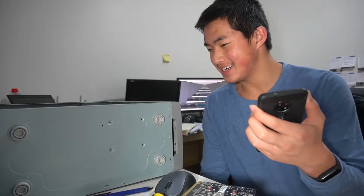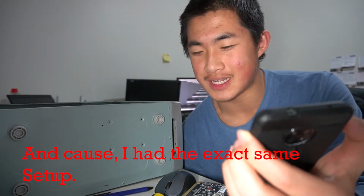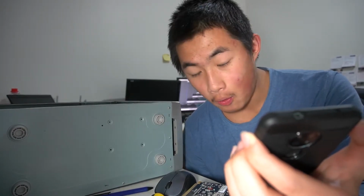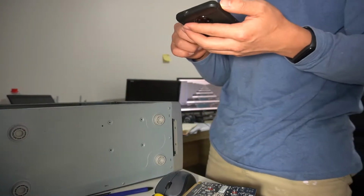So, Kenny, hello? I can tell you right now, and the viewers, that it is a BIOS issue. After a bit of diagnosis, I've just updated the BIOS and I'm about to reinstall the GPU. Are you telling me that I have to come back tomorrow? Yeah, so I pretty much fixed it in about 10 minutes. I'm very confident it's fixed. I'm just going to install the GPU right now. I looked at the diagnosis, and some guy from a forum said if your thing freezes on startup, it's a BIOS update. And I updated the BIOS successfully, and now I'm going to reinstall the graphics card to see if it works. You've made the shortest video on my channel if this thing works. Okay. You're welcome, man. Bye bye.